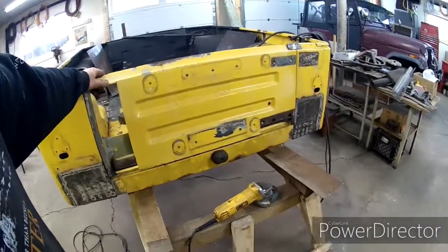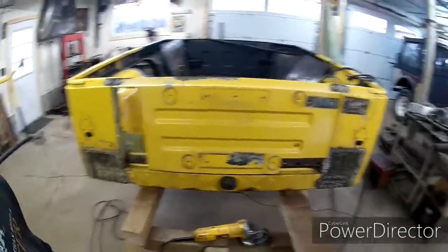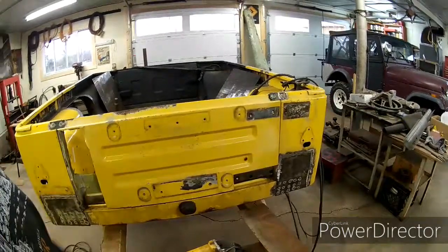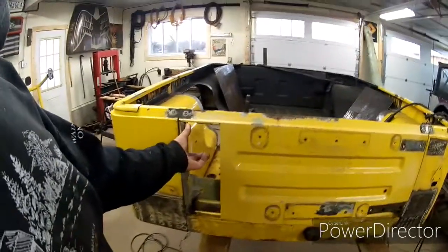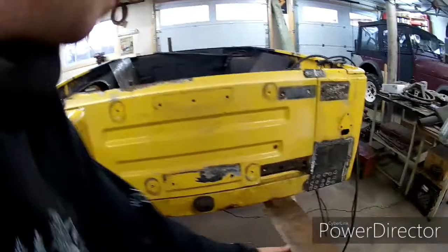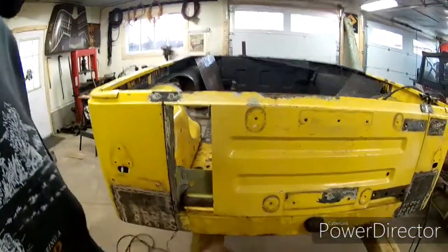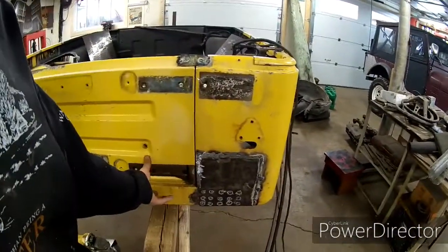Where we're at right now - we've taken the tailgate that came out of this yellow tub. It was pretty rusty and beat up. We cut the various hardware off of it. We wanted to keep the profile across the top, and we'll keep this rib even though it's not centered - it still gives it some strength. We had to cut some pieces out where the latch was, the keyhole and all that - most of it was rusted all across the bottom. We want to close the front of this tub entirely, so we're just going to create a patch which fills in this space and gets stitched right along this edge.